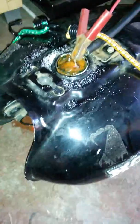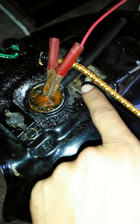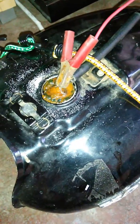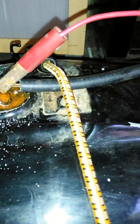The issue you're gonna have with some gas tanks is this rod right here — people try to put it all the way down, but on these little tanks they go like this on each side, so in the middle you're gonna hit metal everywhere. I used fuel line to actually pad it, and I even put some on the bottom of the wire. I coiled it up into a circular motion pointing upwards and made a 90-degree bend so that it sits on this rubber piece with a little bit sticking out.